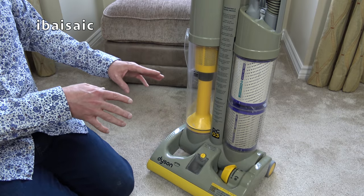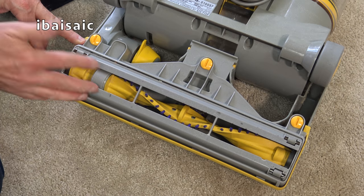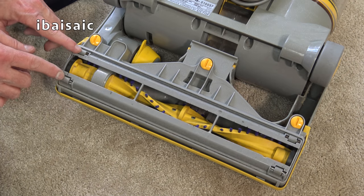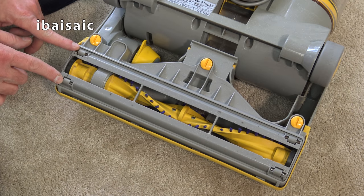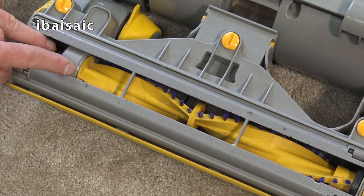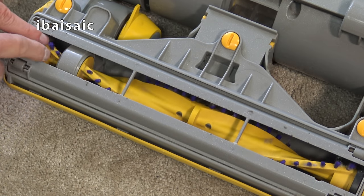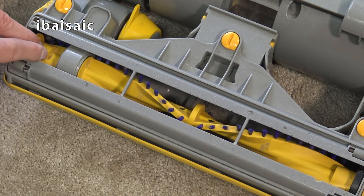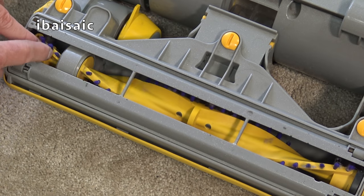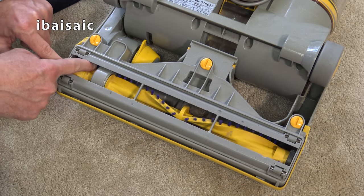So let's start at the bottom. I'll turn the machine over and show you the brush roll. Here's the underside of the cleaner. Again, in very good shape really - I don't think I need to replace this base plate. That is available to buy new or used on eBay, but there's no point in replacing that. The brush roll - I'm not sure if that's how it should be. It is obviously original and that moves very easily. But this is a clutched model, so I'm assuming it's in the hard floor setting at the moment, which means it's not engaging with the motor spindle. I'll have to buy a new belt or belts if needed. It's an odd shape brush roll on these - sort of a helix design. Quite a narrow opening.